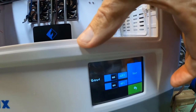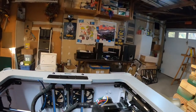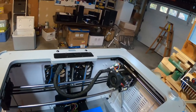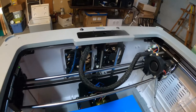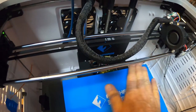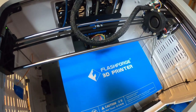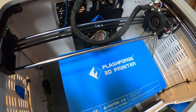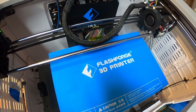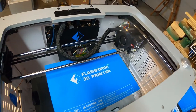Then you're done. Last thing I do is turn off the preheat, then go to Tools and select Home. My printer is all set to go for bed leveling next time. Once it's at home it's very close to where it needs to be for leveling, so that's going to be much quicker the next time you start printing. And that's our procedure.